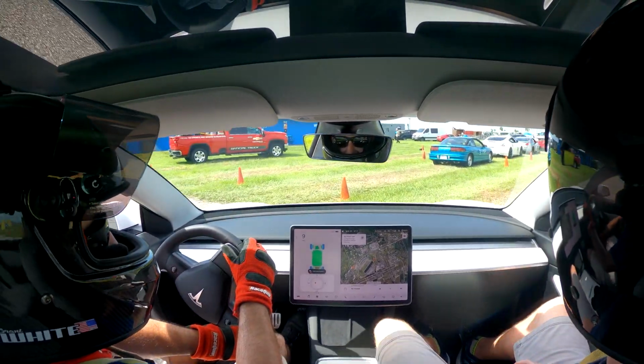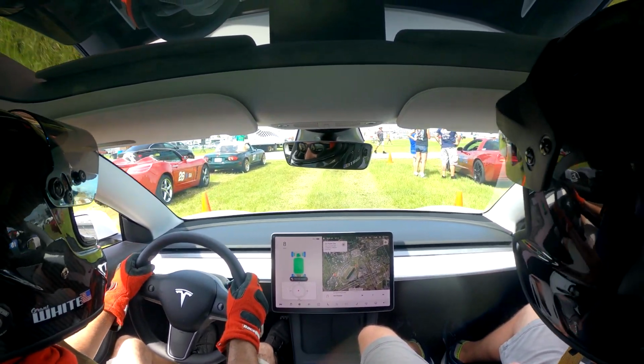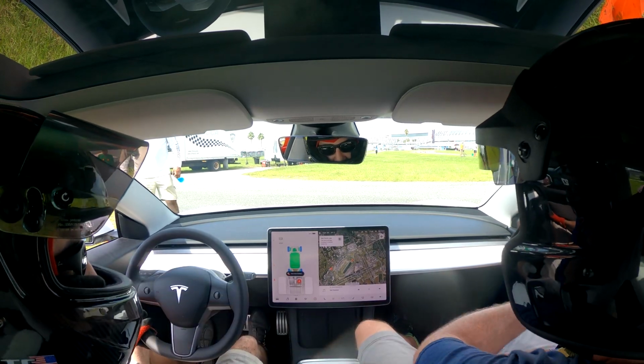We're doing a night event. So I've done zero prep with the car, just stock lights and everything. I didn't put on any crazy light bars, although I don't even know how I'd bolt one on. I guess we'll see. But I definitely think some additional damping on the front dampers, maybe turn up a few clicks up front, and we'll see how that goes. Amelia is going to be a little different than Daytona. At Daytona there's no real slalom, so I'll be interested to see how the dampers handle in a slalom.